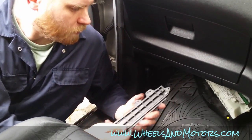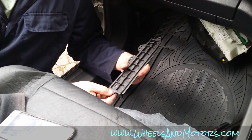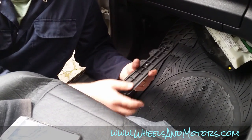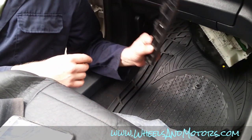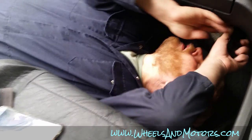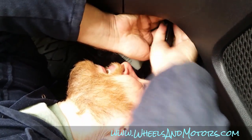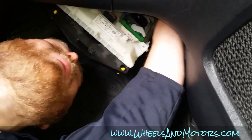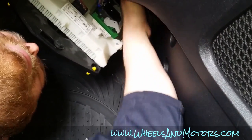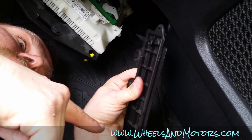This cover is normally held by four screws — we have one missing. Whoever did this job before put the filter wrong way around and lost a screw. We're going to put this back — the best position is to slide this edge in first and then close it.